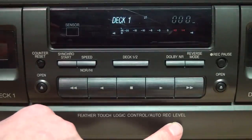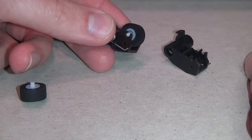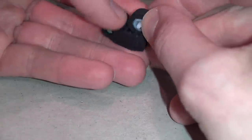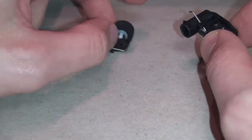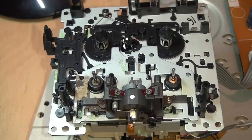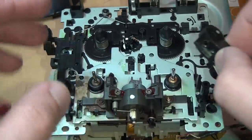Since the belts on this deck are actually still intact, I'm first going to try replacing the pinch rollers and see if that's enough to get it working. Luckily it is rather easy to replace the pinch rollers on this deck because they just snap into place. I take the new pinch roller and snap it in. I was able to fish these out without needing to remove the mechanisms, but getting them back in place required removing the mechanism — though luckily I could do that without removing the front panel. Here I have my assembled pinch rollers ready to pop into place.